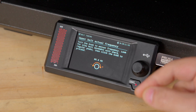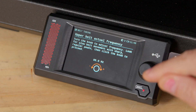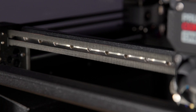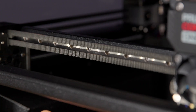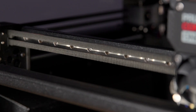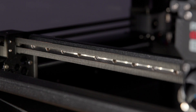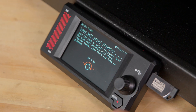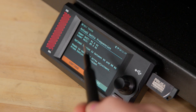Currently it is set at 95 Hz. I'm going to move the dial to change the frequency at which the belts are moving in order to see exactly at which frequency they currently are. At 95 Hz there's barely any movement. If I start lowering it down, I can see much more movement. I have to find the right frequency where I get the most movement back and forth with the highest peaks — and in this case that would be 91.5 Hz. I click OK, telling it that the top belt is currently at 91.5 Hz. Now it's time to do the lower belt. I start lowering the dial to see the frequency of the bottom belt — I'm looking for that movement, and it is currently at 85 Hz. I click OK. It tells me the upper belt is at 91.5 Hz and the lower belt at 85 Hz. It also tells me that the optimal tension for the belt is between 90 and 98 Hz.